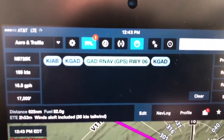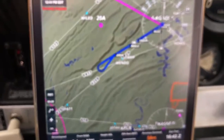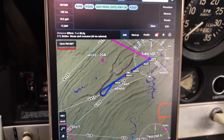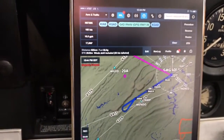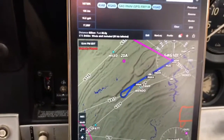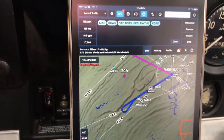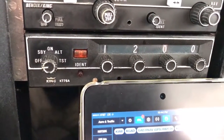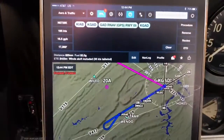Hopefully that shows some of the benefits of the FlightStream 210 and how it can bring new life into your Garmin 430. Don't be trying this with your GTX 345 transponder because unfortunately Garmin left this feature out, and you'd have to spend an extra thousand bucks to buy a FlightStream 210 after already spending money on the 345. The GDL 88 — if you don't need to go over 18,000 feet and you already have a GPS source — the GDL 88 and FlightStream 210 is actually a more capable combination than the 345. This plane still has the KT 76A transponder — if that goes out I'll get one for a hundred bucks on eBay; there's an endless supply of spare transponders now. Alright, hope that helped — if you've got any questions send me a message.